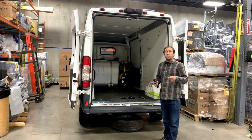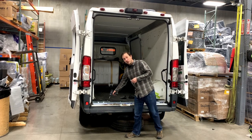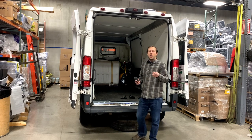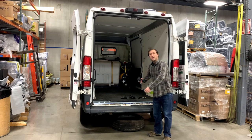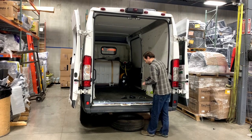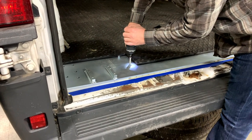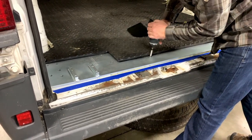The plate has been placed and the first step is to fasten the four bolts across the rear. As mentioned earlier, we used plus nuts so we can just attach these from above and tighten them down. In the provided kit you have bolts, nuts, and washers — put the bolt in the hole and attach from underneath with your washer and nut. Get those four tightened down using a 3/16-inch Allen key to get them all nice and tight.